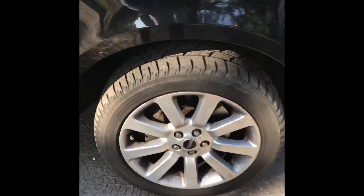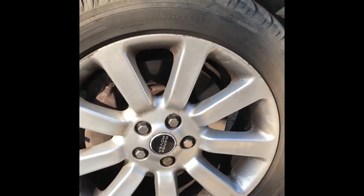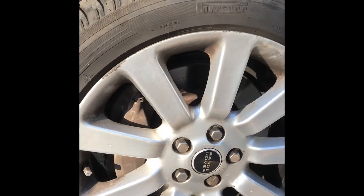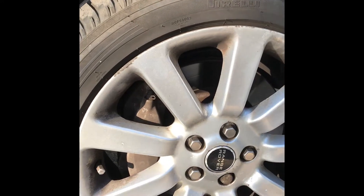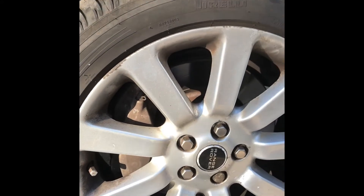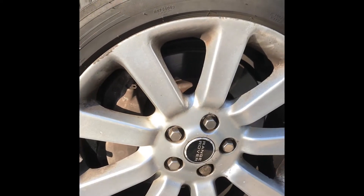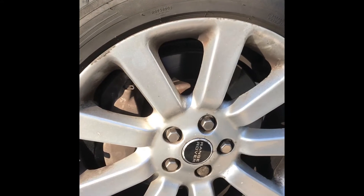There's been a rattling coming out of the front. It sounds like a tin can. I thought it was the dust cover going round the brake disc, but it suddenly clicked - it's probably the hub dust cover. So I need to take the caliper off, it's a Brembo one, take the disc off and check the clearance. This is a 2007 3.6 V8 Range Rover.